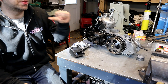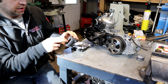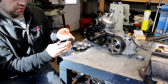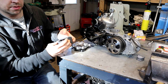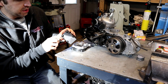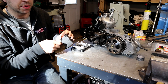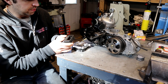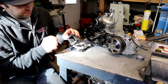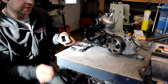It does shoot the carb straight out the side of the bike, which is a bit annoying, but it's a direct shot down. The opening here is about as wide as the leaf petals are going to open all the way, so it cuts down on space inside the intake track since these have such a long intake track. You may need to drill and ream these holes — I used a reamer because they're basically size-for-size. Just be careful, since those two holes are very close to the inner walls, otherwise you may break through and have to do a repair on the inside.